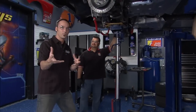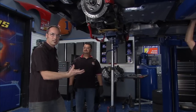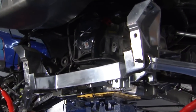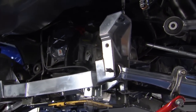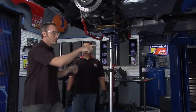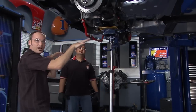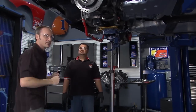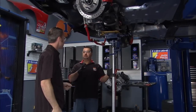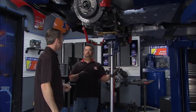Now that's something you're not going to do in your driveway, but with a lift, the proper equipment, and the proper guys with some skills, you could pull this off. We've got our whole transmission and cradle under our trans jack. Once we start lowering it, it's going to be unbolted. We've got to hang on to it, and then Brian can start lowering — we're going to pop this sucker right out from behind that engine. We can get access to that clutch, and we don't really have to move it that far. We just want to get it down far enough.